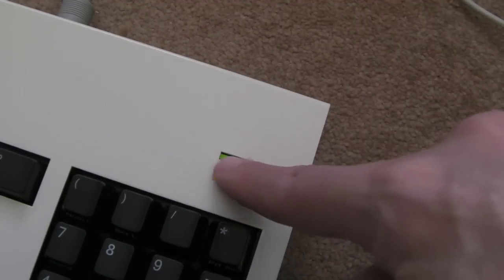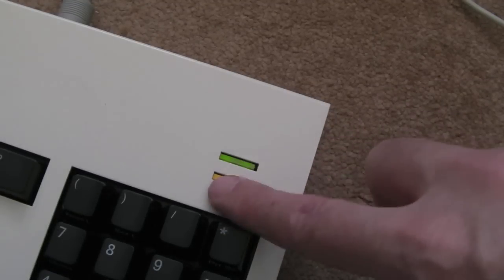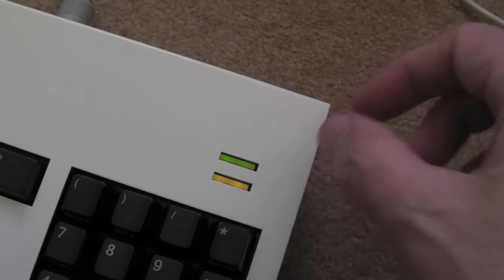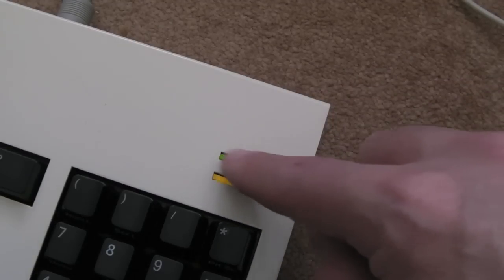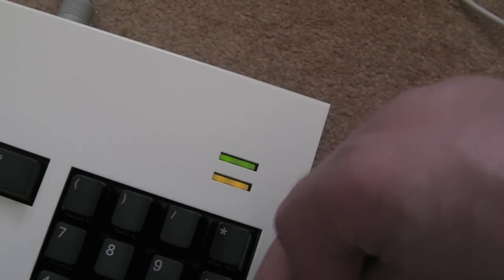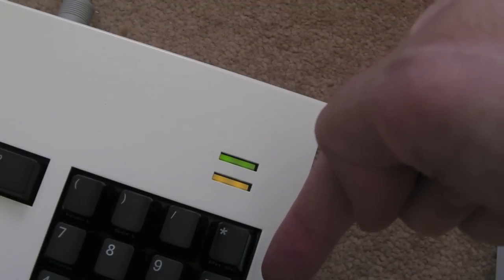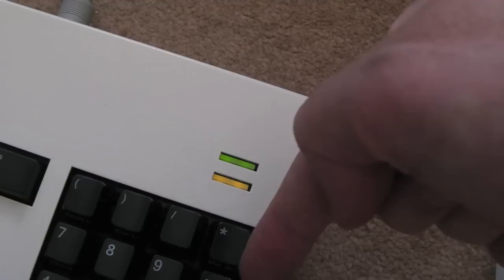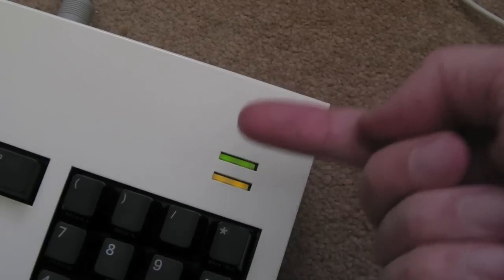I removed the cable that goes to the A500, so that's not flapping inside. The benefit of having the cable come out without a plug on it is you can feed the excess cable back inside, so when it's close up to an A2000 you wouldn't have tons of cable out the back. You could plug it in and just tuck the excess cable in here. Something to point out: before you screw the two screws that hold the keyboard in, if you slide the keyboard all the way to the right then the LEDs are in the perfect position, but they are sunk down — not raised up.